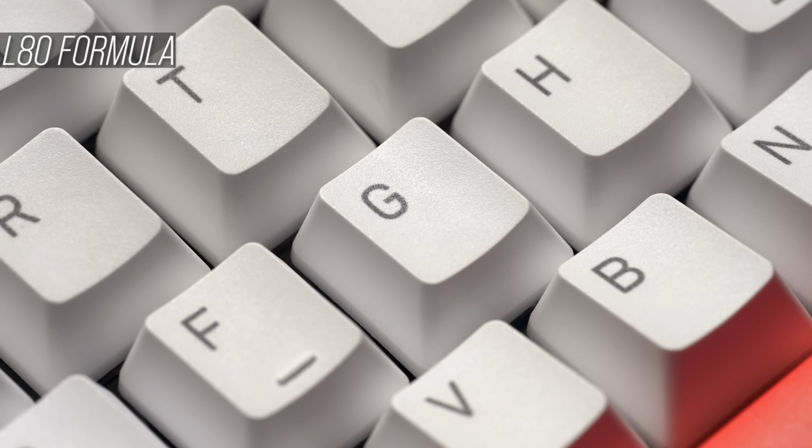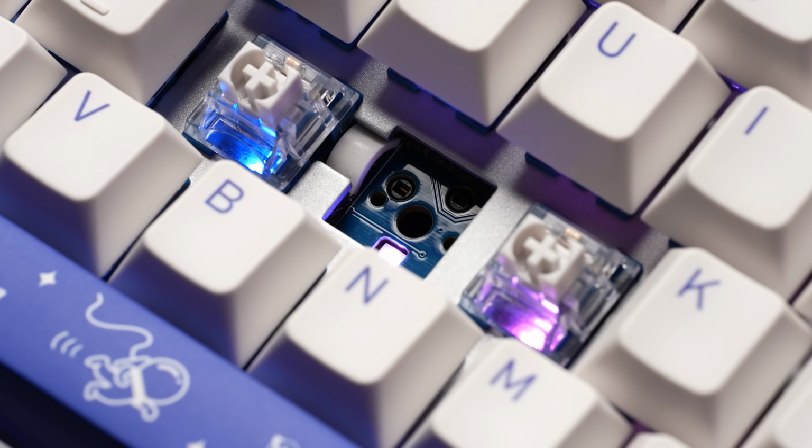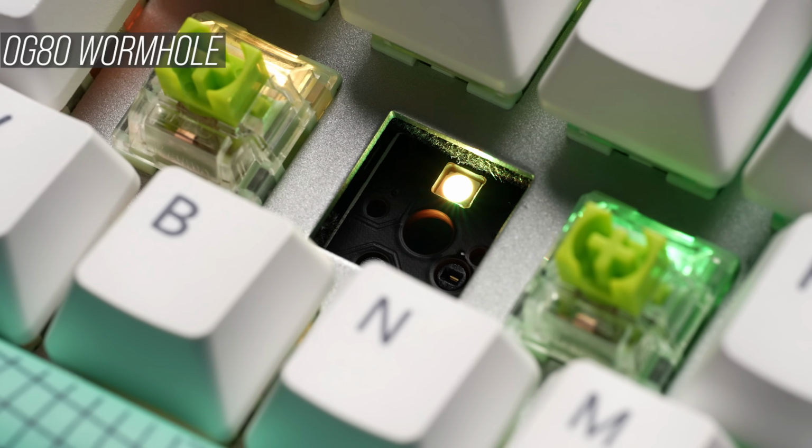None of these boards have backlit keycaps. If having the legends on your keys light up is important to you, if you're going to add aftermarket keycaps, I would avoid the Cosmic Traveler. It's the only one of the bunch that has south-facing LEDs. Every other model has north-facing switches. Like I said earlier, only the Cosmic Traveler has the Cherry plate mount stabs. The rest of these are all CoStar.